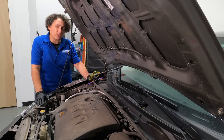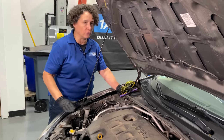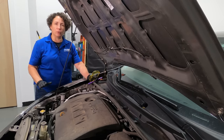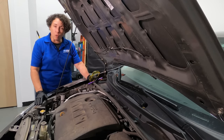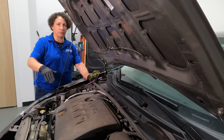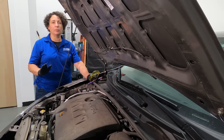Those refrigerators sometimes last 10, 15, 20 years. That Freon does not get old — it doesn't wear its coldness down. If your system is blowing warm, then you have a leak, period. Or you have a system that's not working, so the Freon's not passing through. But mostly, 90% of the time, it's as simple as a leak.